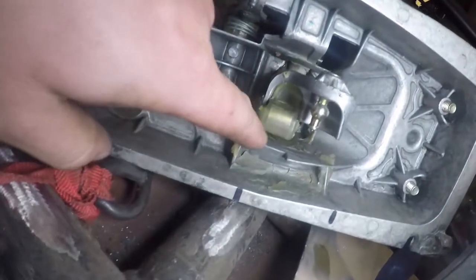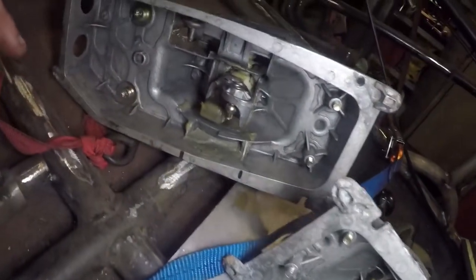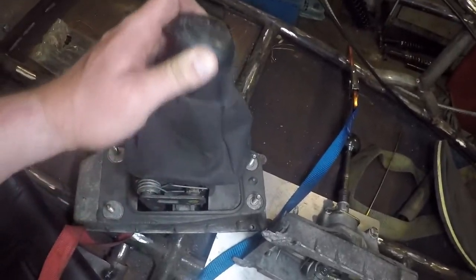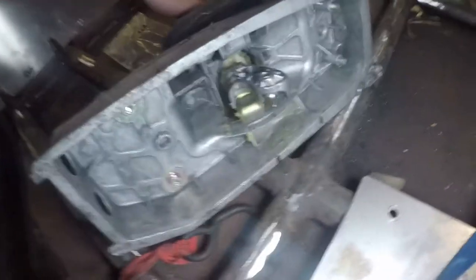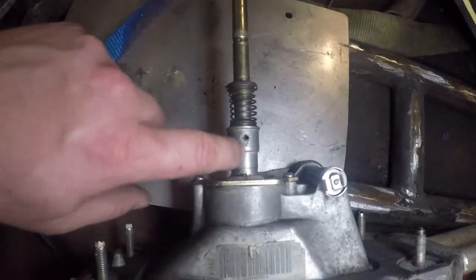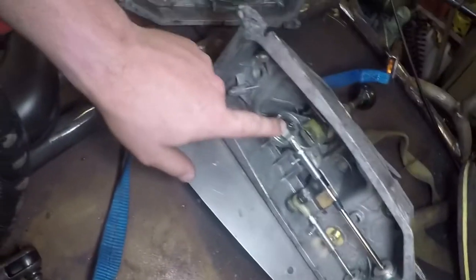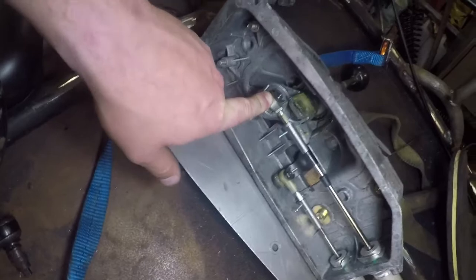So the standard gear selector pushes up and down to go into the reverse gate. I've not bolted it down yet because I don't really know where it's going to be positioned — it's just strapped in place. If you look under here, before and after: the standard one has a hook that hooks into the channel for reverse. I needed as much left and right on the gear stick as possible to get into the gate on the gearbox, and that hook was hitting things. So I simply cut it off — there's no hook, no reverse gate — and drilled a hole and popped a roll pin in to stop it going up and down. It's just a fixed gear stick now.